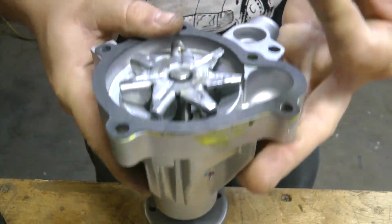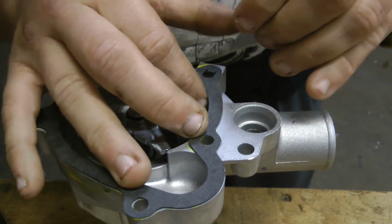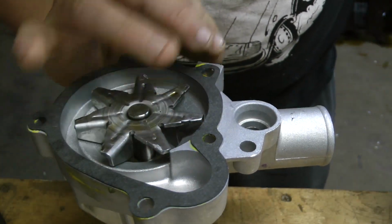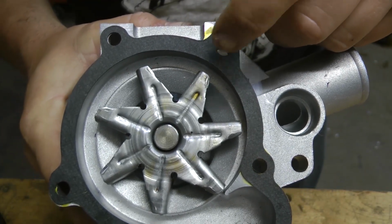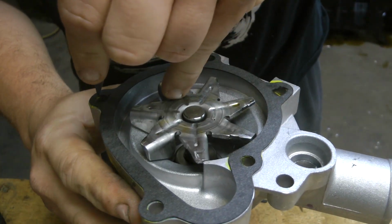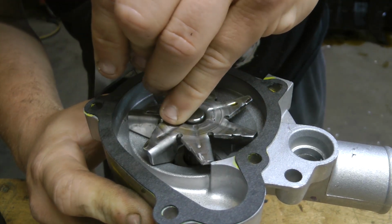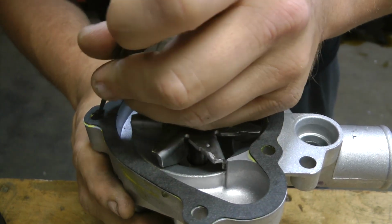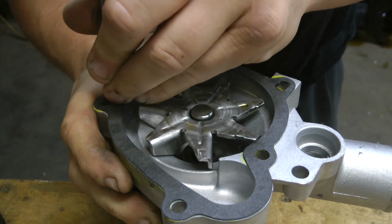Also, pro tip, install your studs first and it'll stand up. So I'm just going to take a razor blade and cut the inside of that as far as it'll go, and then just notch it off. Now, it's not the prettiest cut. You can see how much gasket was hiding the hole. Fighting that is just a fool's errand. So I'm going to cut the other one. Then I just go around the holes with a pick to flush it up. It doesn't have to be super pretty.